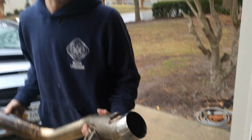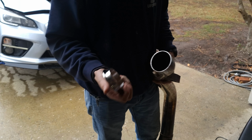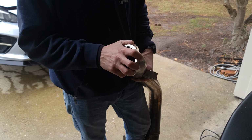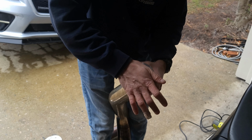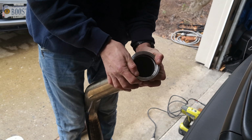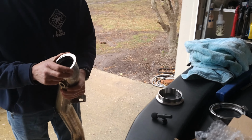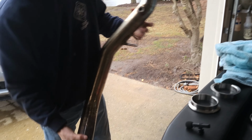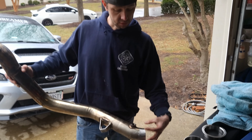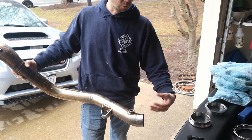This cut, we went ahead and cut that flange off that you showed on your last shot. We got a nice square cut on it, and the V-bands, some of them have this little offset ring, to where the inside diameter is a little bit bigger than the 3-inch, so that it can just fit right over and help hold it nice and square on the pipe. Once you get it on there, you can do a nice weld around the side of it. And I like these better because when you go later on to fit up the rest of the exhaust, if something's off alignment a little bit, it allows you to loosen up the clamp, rotate it to get the angle you want, and then just retorque it down.